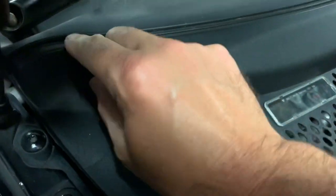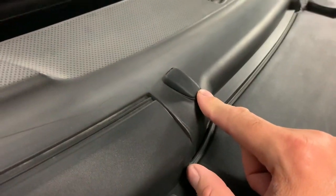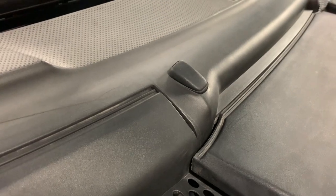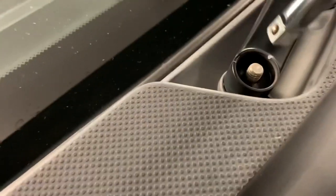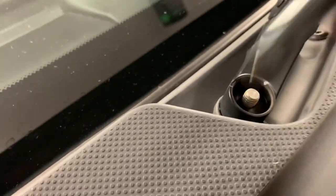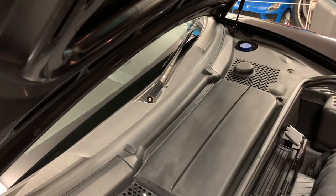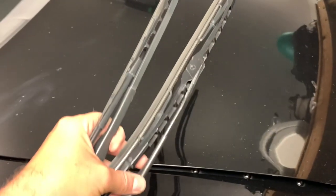We want to unclip all these panels - they're just lightly clipped in so when we pull up it should just come off. We do have the washer sprayers so we'll have to disconnect these little nozzles from the inside. The way these are held on - I took that one off, it's a spline driver, you can see it's got a taper to it, held on with that nut. You just kind of have to give it a few taps with a little extension - that's enough to loosen it up. A little wiggle, and you might need some penetrating oil if you're in an area with a lot of corrosion, but this one came off real easy.